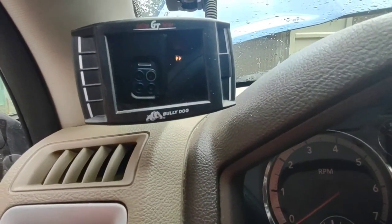He adjusted the fan temperature to kick on at 212°F. When I'm cruising, the truck really runs around 205–206°F; sometimes 203°F. If I'm really climbing a hill with a trailer it'll go up to 210 or maybe 212°F and the fan will kick on — that's what it should do. I have the Bully Dog GT programmer, and with it you cannot change the fan temperature. I believe the Diablo Sport, if you don't already have a programmer, allows you to change the fan temp — it gives you a lot more options.